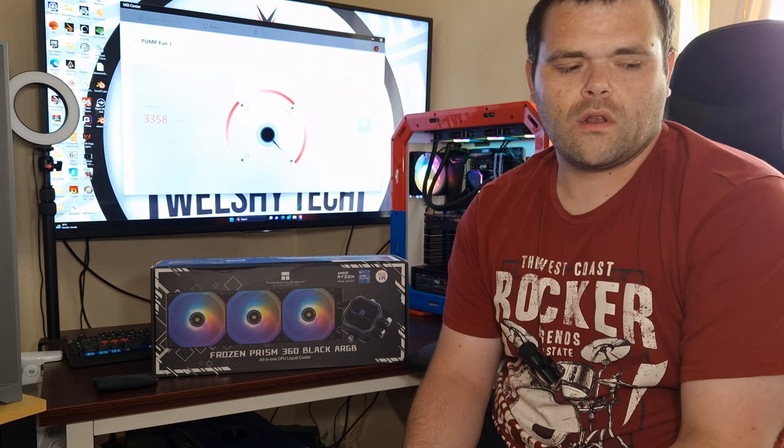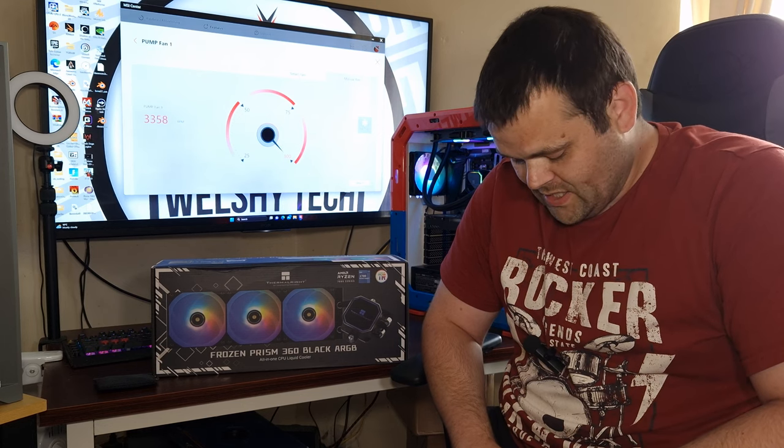So you had the thermals — I've added two different sets of testing, with the second adjusted for voltage and higher clock speeds and wattage. What I will say is this AIO handled it no problem at all. Remember, 1.3 volts on this CPU is rather high — I'd never run it full tilt like that full time. With AMD Ryzen and PBO enabled, it generally overclocks itself really well, but I did this to show that even at higher wattages this AIO can still handle it.